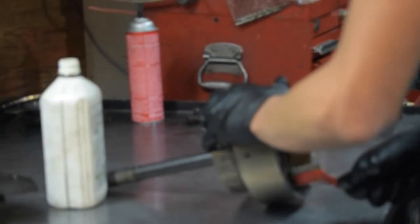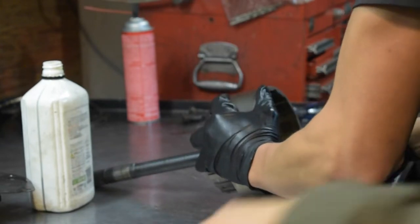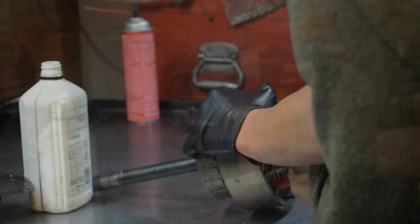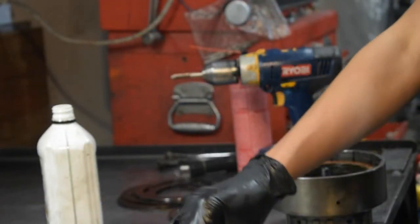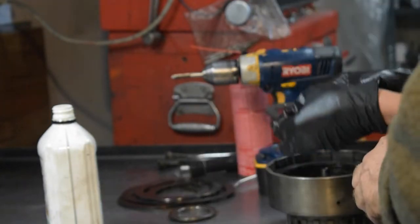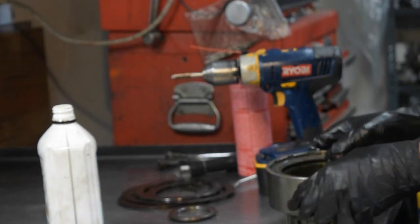We're going to clean that up. Still a big gap? Oh - so we can get six in there? Let me see. We've got room for another clutch. So we'll take the thicker plate and take off 20 thousandths, just to give us a little extra volume for fluid, and then we'll get a real measurement and see where we're at.